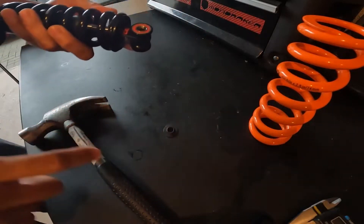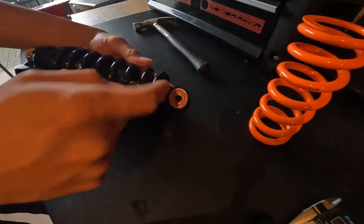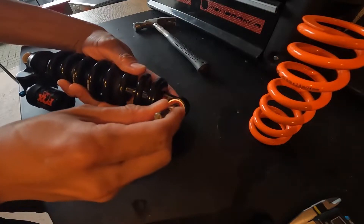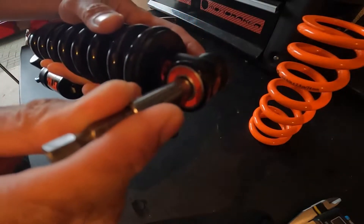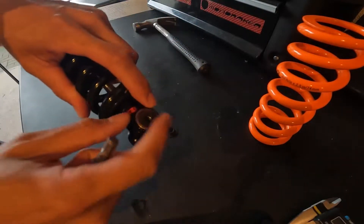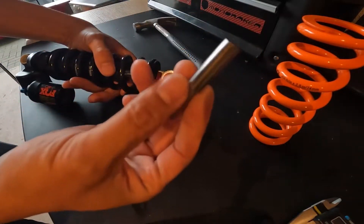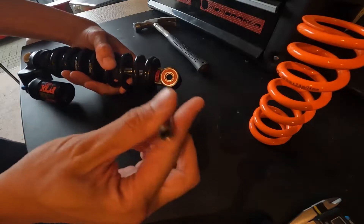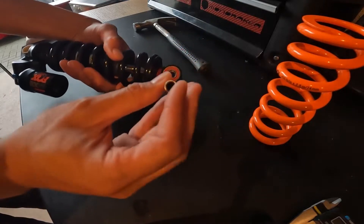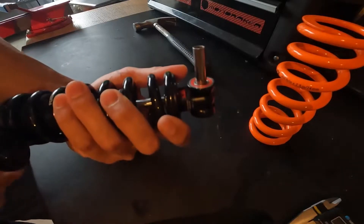You need — if you get the proper Fox tools you'll get a 9.8 or just under a 10mm cylinder which will fit in there and let you punch out the pin inside, which is a friction fit. Luckily I have this socket extender for a screwdriver, and that's exactly 9.9mm — just under 10mm on the outside diameter — so it fits in perfectly and sits against the pin.